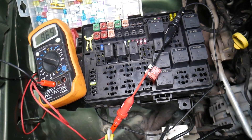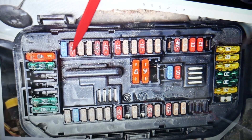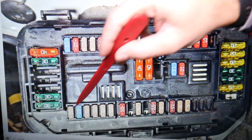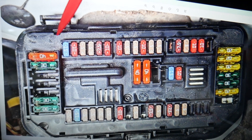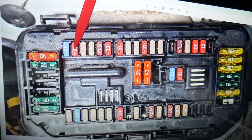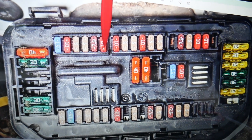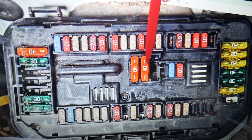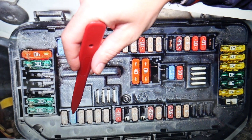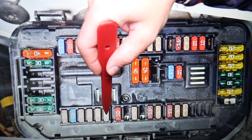Check out the links in the description below. Here you'll need to check multiple fuses. Starting in the row towards the windshield — that's the front of the BMW — on the passenger side and driver side, you need to check fuse numbers 19, 21, and 23. Also check fuse numbers 36, 37, 43, 44, 45, 46, and 47.